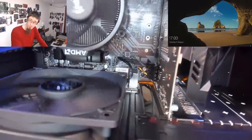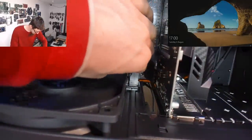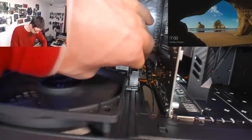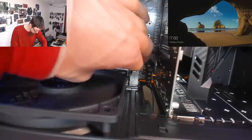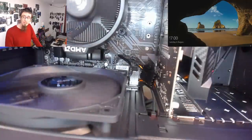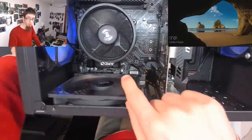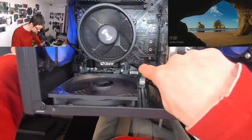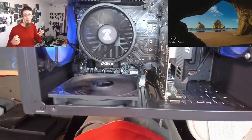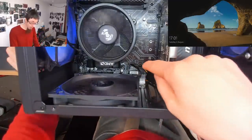Moving around as well, I don't like this. This is the rear fan cable, and it's got a 4-pin Molex lead that's just flapping around in the breeze. That's 12 and 5 volt hot, that wire, and the Molex connector is rather exposed, so I don't like that being there at all. If you've bought a budget case that has come with one of these fans that has the 3 and 4 pin with the Molex tail on it, just chop the tail off. Don't use it, just chop it off. We'll be doing that in a minute. I'm just going to lop that off.